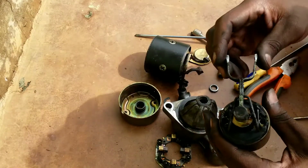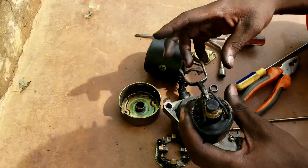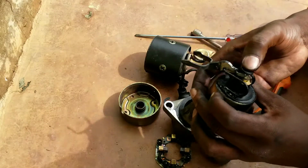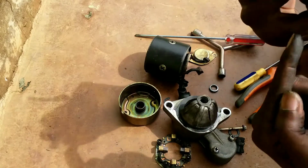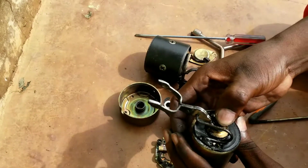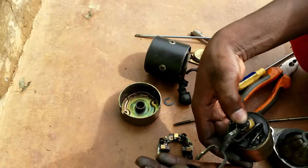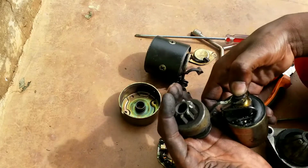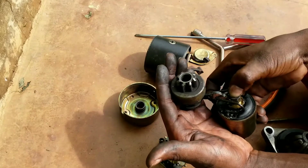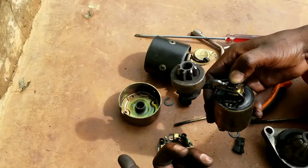So when you pull this one out, it comes in this format, just like this. This is the spring tension, which is activated by the key terminal right here. It pulls in. In the process of pulling in, it forces the plunger to move forward. You see that? So it pulls in as the plunger goes out to mesh with the flywheel, and it rotates.